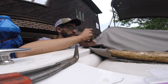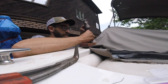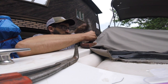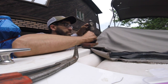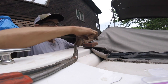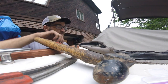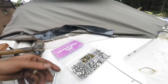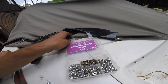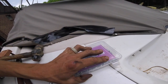do that, and it comes with this peening tool that sits, and I have a block of wood just so I don't smack the fiberglass, and you hold it down and peen it over. That's it right there. Let's see how it fits. Perfect. Now there are different size rivets, so you might have to buy different kits. This one came with the screw-in pieces, which I don't actually need right now, and 3/8 stuff. It was pretty cheap, like $9. I'll put a link below.